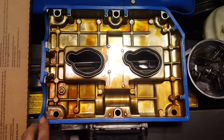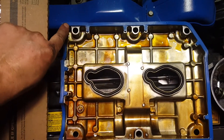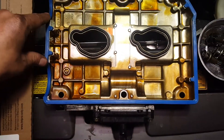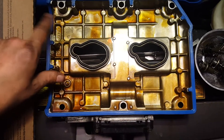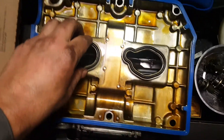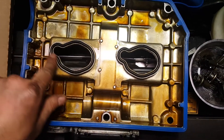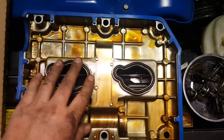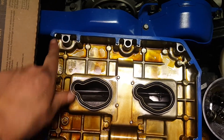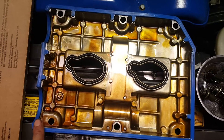I'm going to follow the reverse order to put it back together. I'm going to put a little bit of packing fluid on the corners where the cam seals are, and let it tack up for about 5 to 10 minutes before putting it in. I've already replaced the spark plug tube seals — the ones they sent with the kit were actually square, but these ones are more oval-rounded for this valve cover design, which is what makes this valve cover design so unique on this 99 model. I'll put packing fluid on the corner of each cam seal: here, here, here, and in this corner.